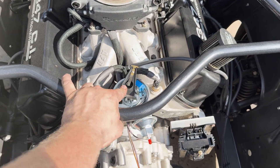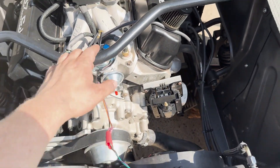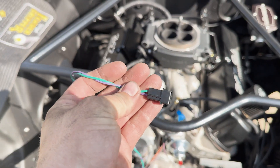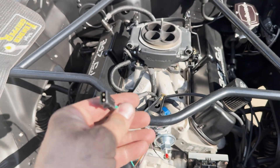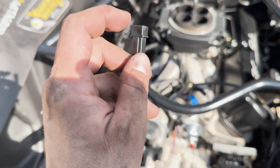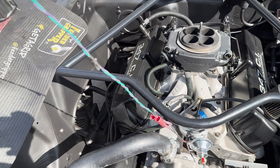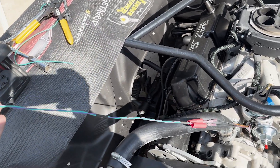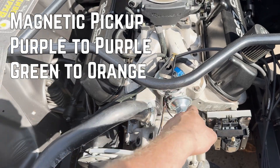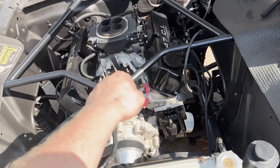I've got the distributor locked down, lined up at 45 degrees before top dead center. The number one terminal is going to be right about here on the cap. This goes to the ignition circuit for the Sniper. I had to add a green wire to it — it comes with only the purple wire. I used a regular single-pin terminal and twisted them together because that'll make a less noisy signal going into the Sniper. Connected them to the wires from the variable reluctor — we'll loom it after we've made sure everything works.